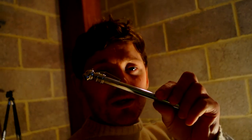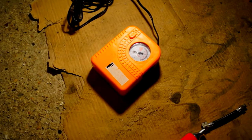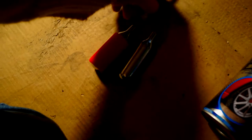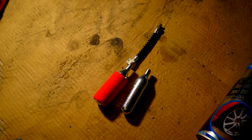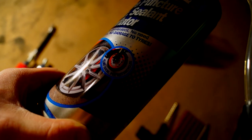The last thing to talk about is flat tyres. Always carry a tyre gauge so you can measure how much pressure is in your tyre and if it's got enough. Then you've got a couple of options to top up. You've got these hand-sized compressors — very small, but obviously electronics are bulky and they can and may fail. And then you've got CO2 cartridges, which are probably the smallest and most effective way to top your tyre up. And then if you get a puncture you've got a plug kit or tyre sealant, but make sure your tyre sealant is suitable for motorbikes.